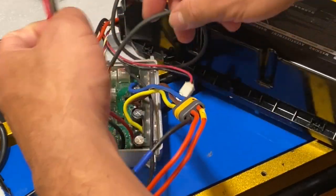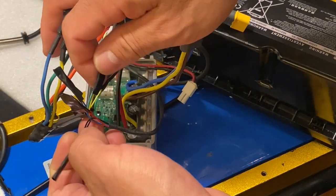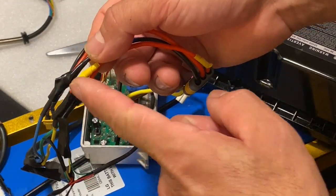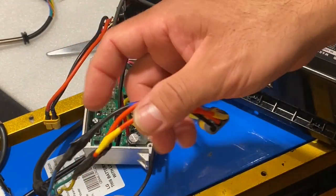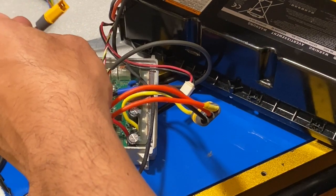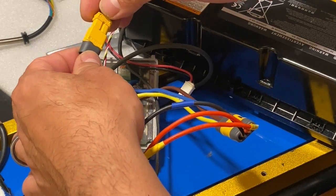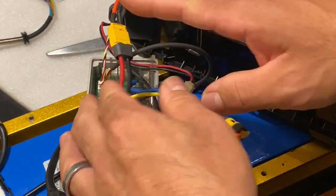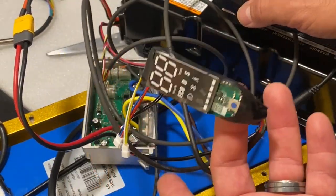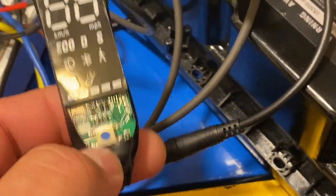So we have all the connections ready. The only thing I want to double-check is that I don't have any bare wires, because that will definitely damage my controller. As we can see, the wire tips are out but not touching each other. It's very important to do all this testing before putting things together, because a short will definitely halt the scooter. A little spark when it connects is no problem at all — that's the same as what you use in the scooter, so no worries there.